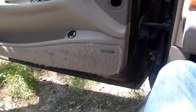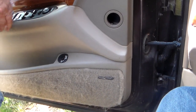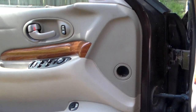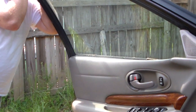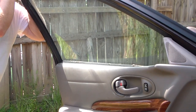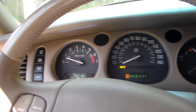It's got a Concert Sound 2 system. Smell that. It smells like a little fuel that's getting drawn in, too much fuel or something. Smells rank. I hope that fuel pressure regulator up there ain't acting up on this one. It may not be a vacuum leak, because we ain't got a service engine light on yet. Hey, there it went.